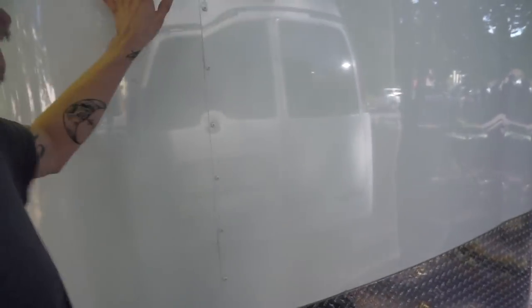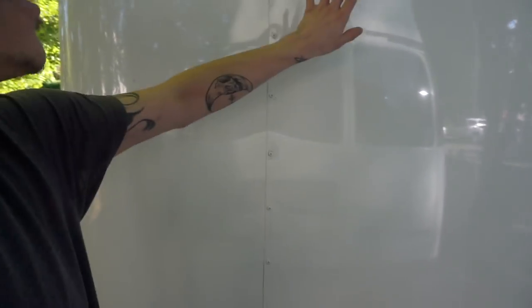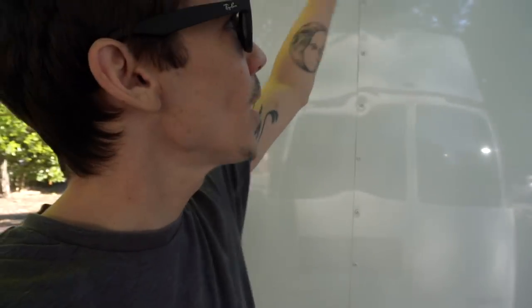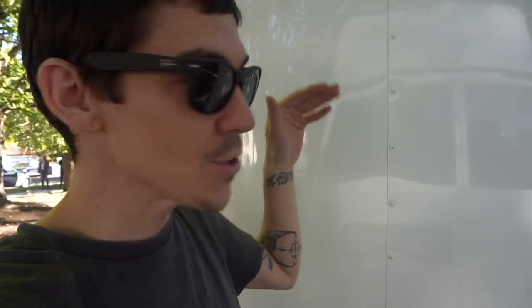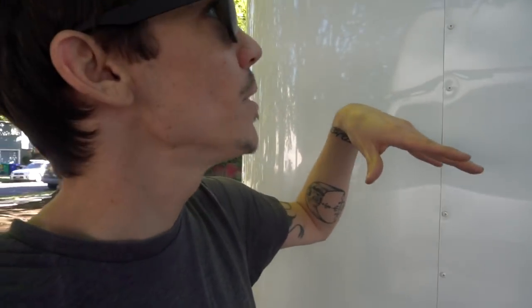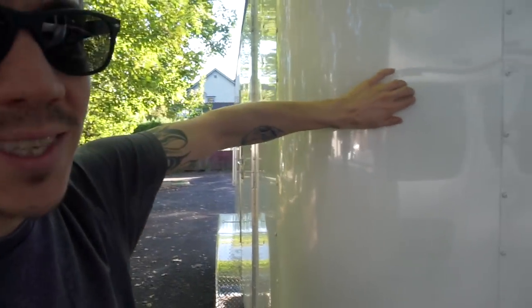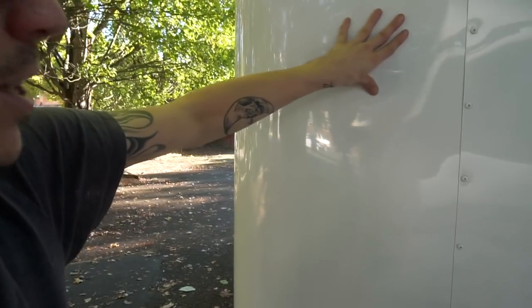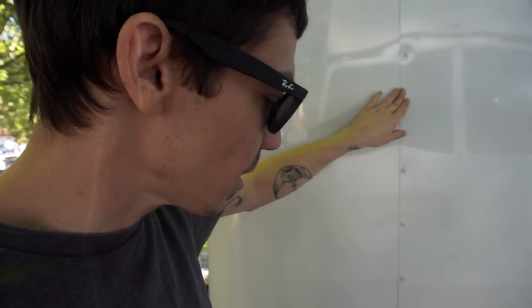Trailers come in a slightly rounded front with a rounded roof or a V-nose. The flat roof has issues — on these particular trailers they give a lifetime warranty on the rounded roofs because when it rains and snows, water just goes right off the side. With a flat roof, the aluminum is thin enough that water weight pushes it in and works into the seams. We also get storage space up top — probably three propane tanks and a toolbox.